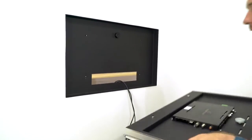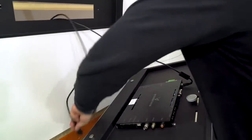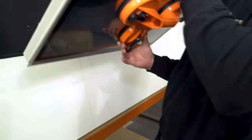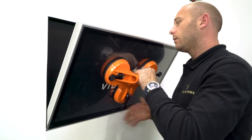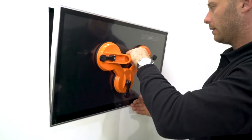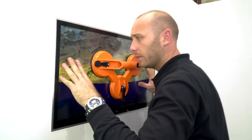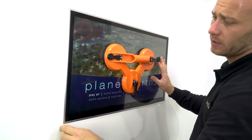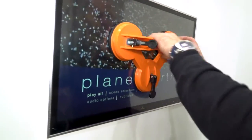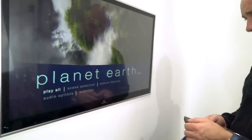Plug the cables back in. Locate the TV at the bottom of the back box and do not have any obstruction cables in the way. Insert your TV so you hear the magnets grab — push. You may find some excess silicone squeezes out; clean all that off. Remove the glass sucker and test the screen.